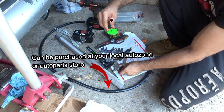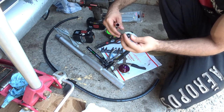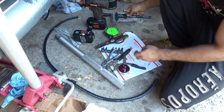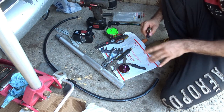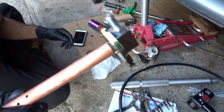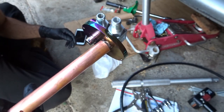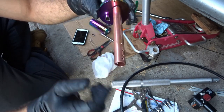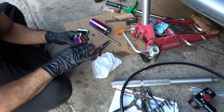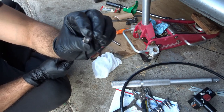That little piece came from the three-eighths line I bought for my connections — it acts as my gasket. Guys, a digital caliper is a necessary tool if you do a lot of custom work — I'll put a link in the description. As a test fit, you can see it's nice and snug — that's as far as it goes, but that's fine. I'm going to put RTV all the way around on the inside and let it sit for about an hour or two. I had to shave it a little more, but it acts as a good washer and does the job.